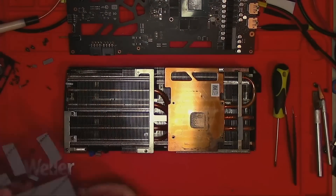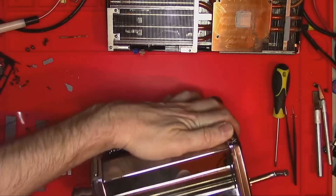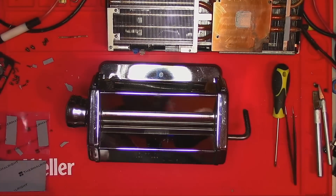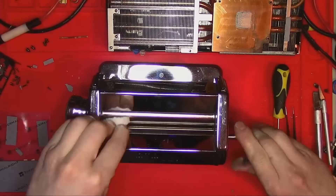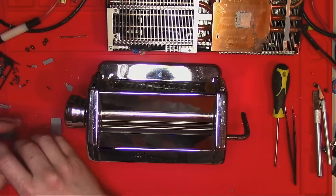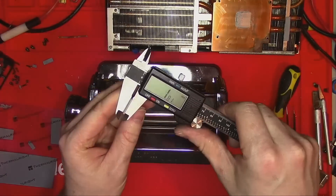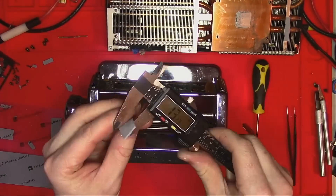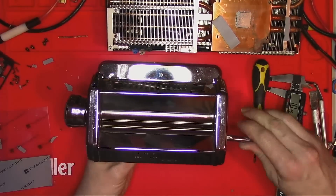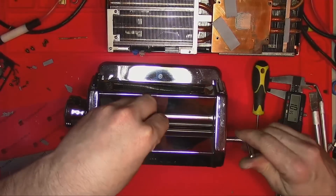Correct. We turn a 2mm pad into a 1.75mm pad using this out-of-space technology device. I'll give it a quick wipe so it does not contaminate the pads, then take those previously cut pads and simply run them through this device to make them thinner with every pass. Every pass I make, I'll take measurements to make sure I don't push it too far. I'll do the same with the rest of the pads, then put them where they belong.